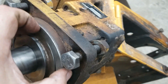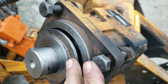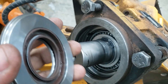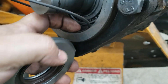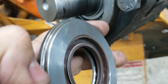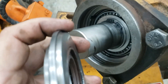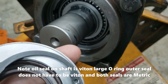Once that's off, this will come up. You may have to put a screwdriver right there and just pry a little bit because it has a seal. I'll show you the seal here — the seal came off because I just put it on here. There it is. The seal rides right here in this outer race, and mine had a little bit of dirt and a little bit of corrosion.